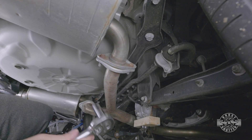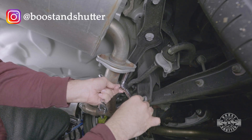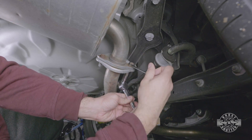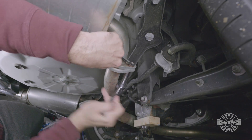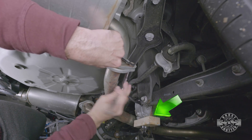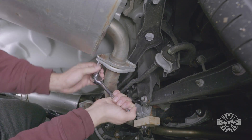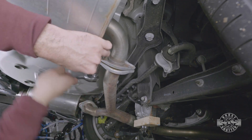To start this installation we have to remove the mufflers. For this we're going to need a 14 millimeter deep socket and a 14 millimeter wrench to remove the two bolts holding it in place. As you can imagine this install will require you to lift your car some. A full-blown lift would be great. I don't currently have access to one so I simply used rhino ramps in the rear and jack stands in the front. You can see here that I also have the car supported on a second point right over the rear differential for safety, and in the front I have another jack over the center frame as well. However you raise your car, always have at least two points of support. Safety is super important when working under your car.